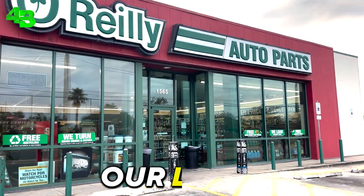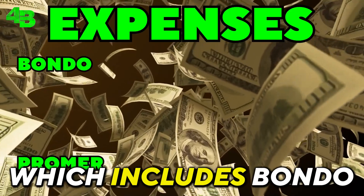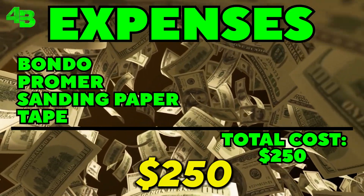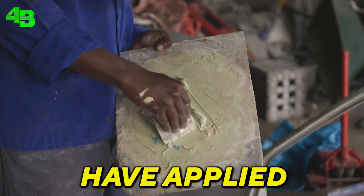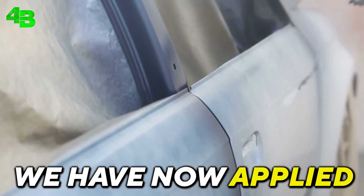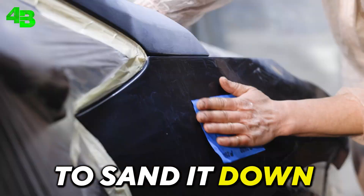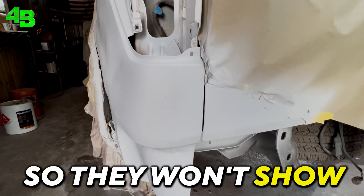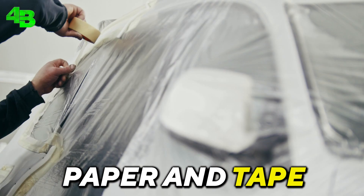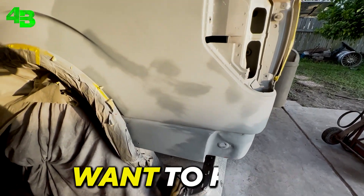Now that we've straightened the rear panel as much as we could, it's time to go to our local paint store and get the materials for this project, which includes bondo, primer, sanding paper, and tape — giving us a total of around $250. We've already applied the bondo and gave the bed the form it needs to be prepped for primer. We've now applied primer onto the section that needs to be painted, then sanded it down and fixed all the minor details. Make sure to remove all the old tape and paper so dust won't fall onto the freshly painted parts, and retape all areas you don't want to paint.